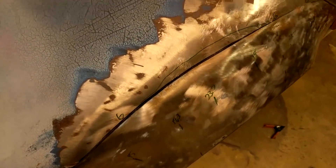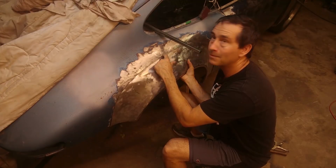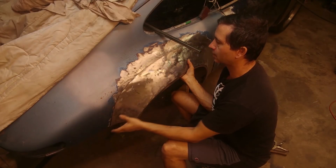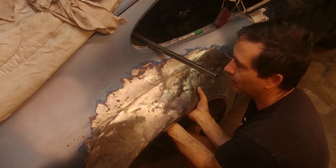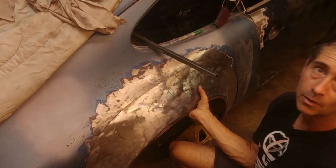This is probably due to some previous damage on this fender. I'm sort of fixing the damage and pulling it out. If I push from the back side it will mate up, but I don't want to weld this with all the pressure of having to push it up — I want it to be completely relaxed before I attempt to weld it on. It doesn't take many hits to stretch that metal out, especially when it's unconstrained like that in the open. I'm using very light pressure — just poking with one finger to pull it forward. I'll hammer just a little more to pull out that gap, and then we're ready to start trimming and tacking.